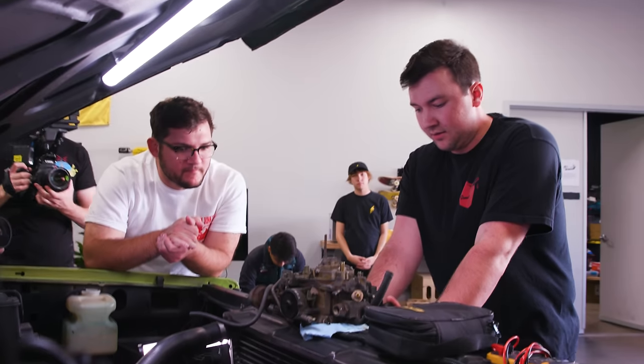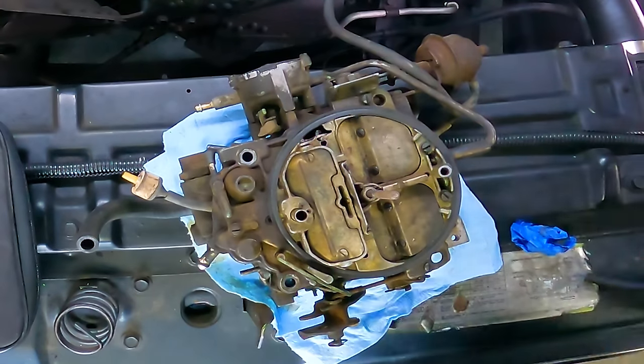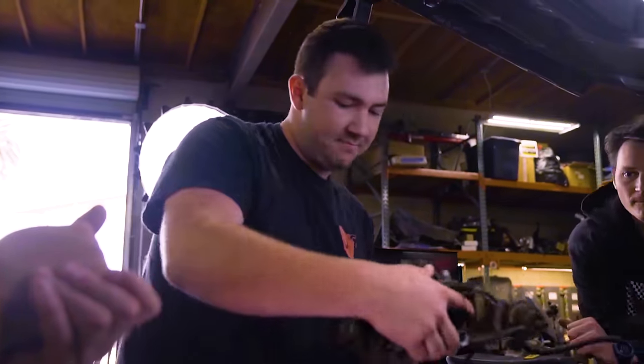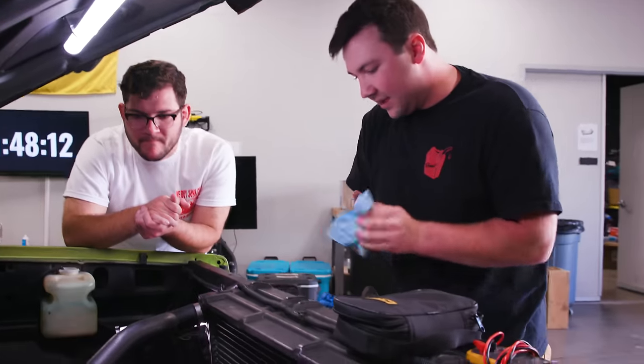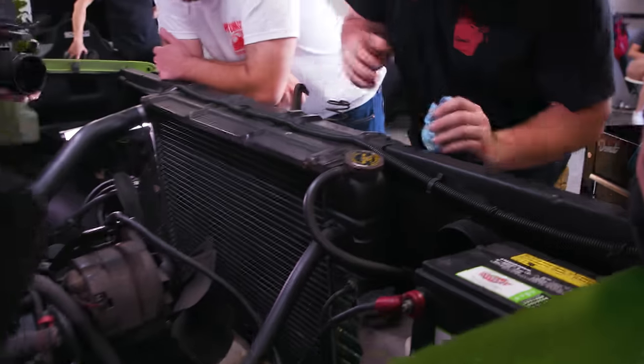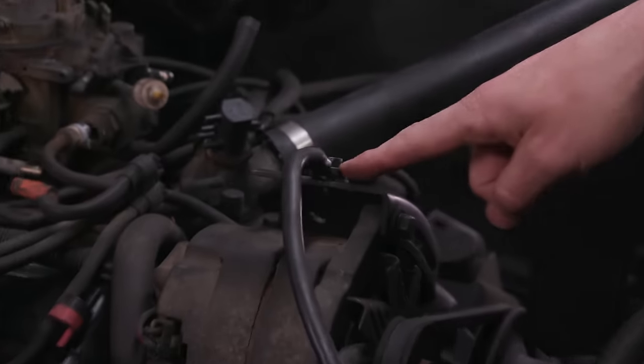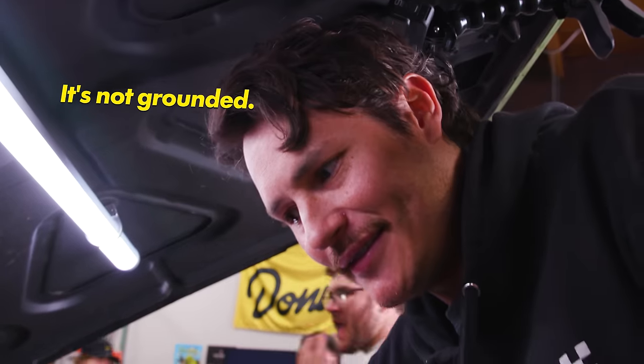I'm used to Autolite 4100s. It's basically the Ford version of this. Ah, okay. So same principles probably apply. It's virtually the same. I'm still a little concerned though, because I don't have power. I think I'm gonna have to get under real quick just to take a peek. All right. Just to take a peek. Get on under there. Right now I'm checking to see if the starter is actually connected, and I do see a starter, so that's good now. Wire, where do you go?